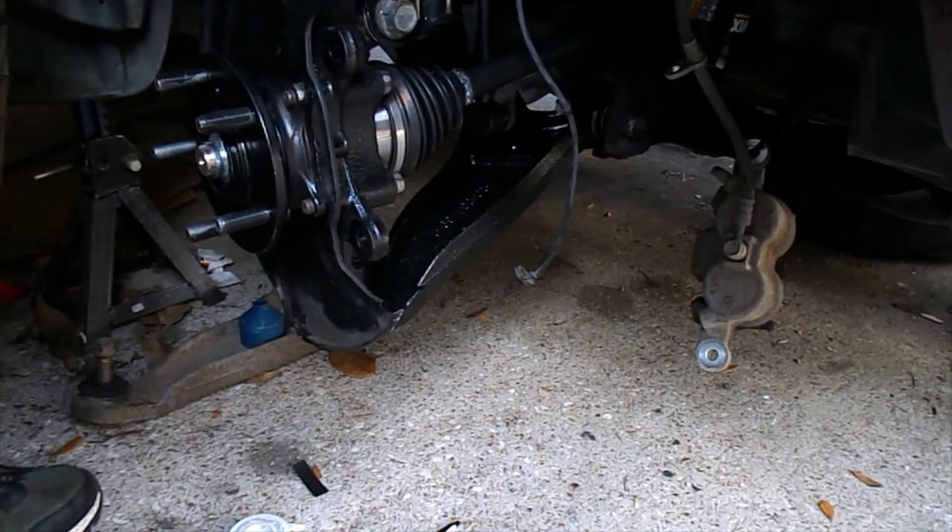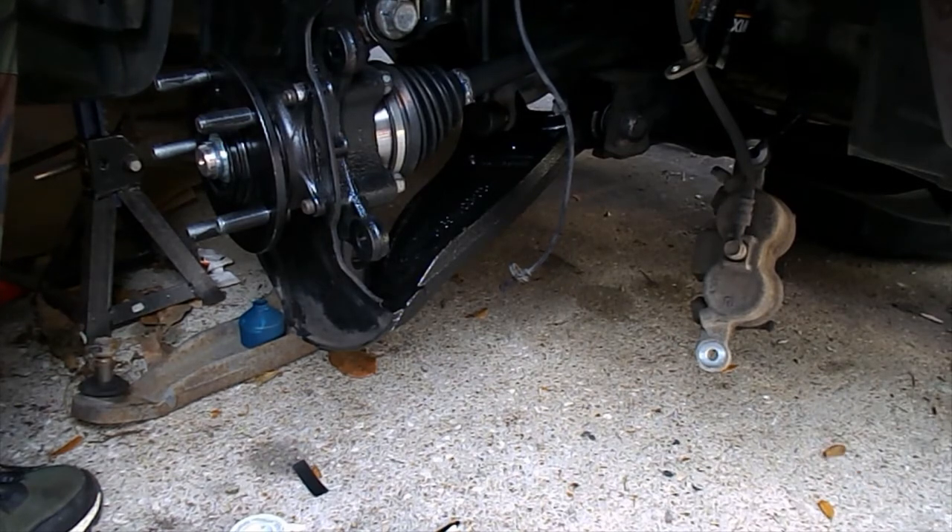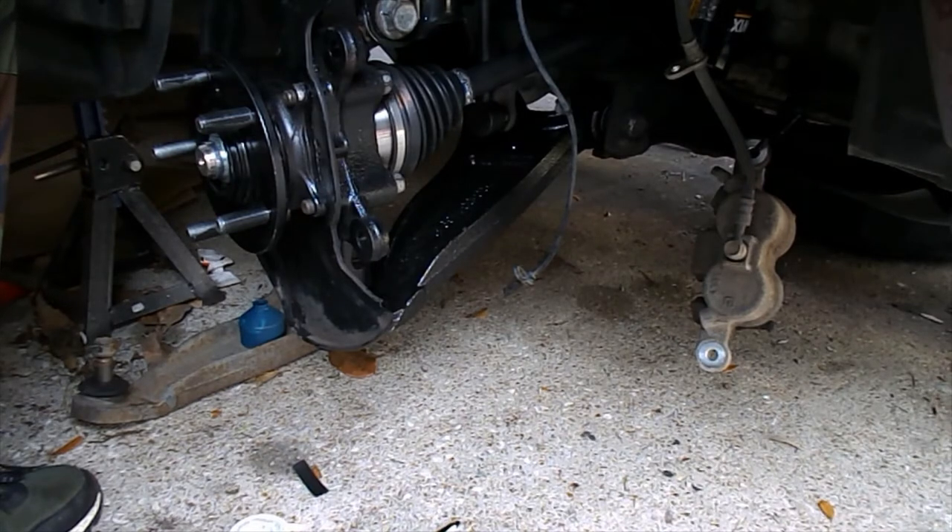The seven-eighths-inch hole has the machined tapered insert installed, so the tie rod fits in perfectly. The lower strut bolt is from the Ridgeline; the hole in the Odyssey knuckle was enlarged to accommodate it. The upper bolt is still the Odyssey bolt. I've got new longer bolts on order because these are borderline too short — the threads weren't fully engaging the nut. I expect them this coming Wednesday. The Odyssey nut will work on the new bolt, so grab the whole bolt-and-nut assembly from the junkyard.